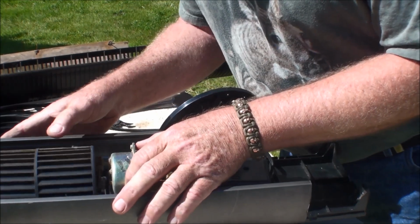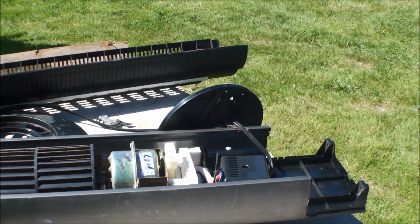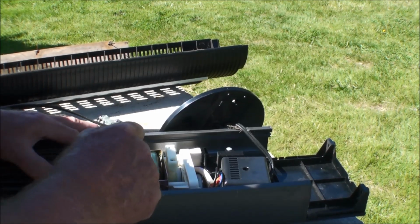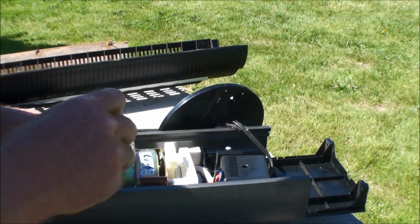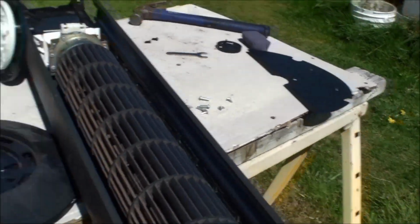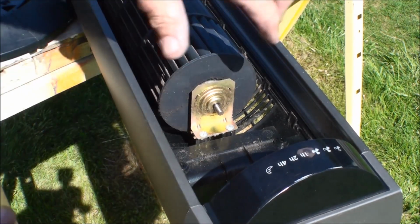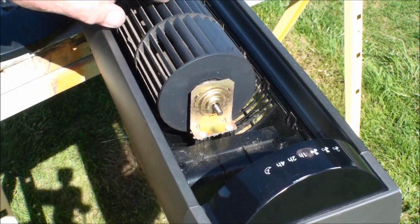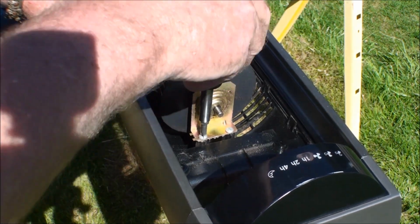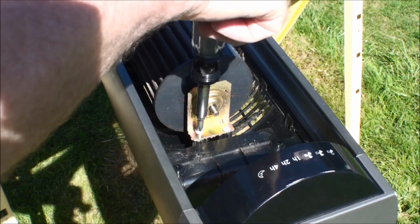And let's see here. See, I want to take this fan off. So, by the looks of it, there is a screw here I'll loosen, and just need to loosen it to get it off the motor. And then over here, hold on a second. Over here you can see these two screws need to come out so we can lift this out and slide it off the motor, and we can take and put this in the shower to wash all the dirt off compared to just brushing it or blowing it. And then we can also oil the bearings maybe a little bit better.